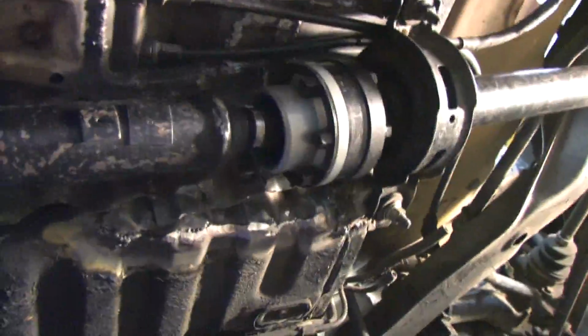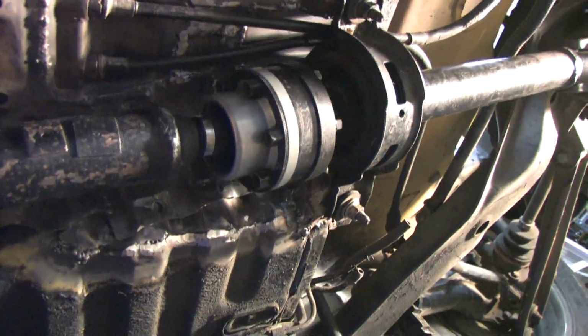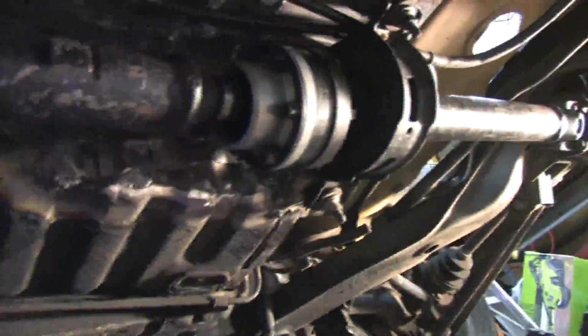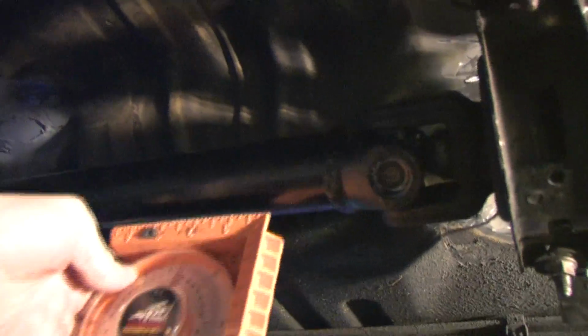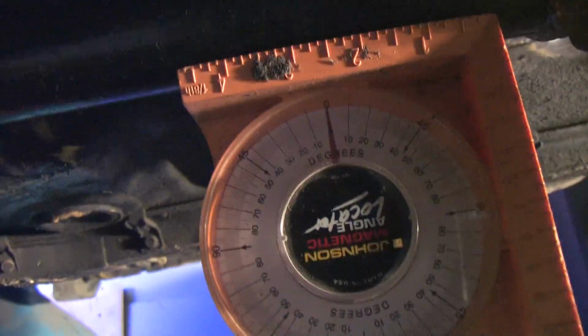The key is to get the Lobro joint in its sweet spot, which is basically dead center on its wear marks. This needs to be accomplished while the front yoke stays buried in the transfer case and the rear is bolted up. The position of the front carrier mount will allow you to do this if the front shaft is the right length. You get a little wiggle room until you weld it in so you can fine tune it. Another thing to pay close attention to is its pinion angles. I can't find a spec for this, not for a DSM.